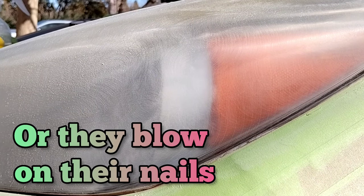But forced air is king. With forced air, you're not only getting a large amount of air and current dumped on the headlight — which speeds up the chemical exchange of the air drying, kind of like superglue — but it also pushes away any kind of debris that might float over. Air drying is best for clarity. It almost enhances the clarity. It lets the chemical do what it's supposed to do.